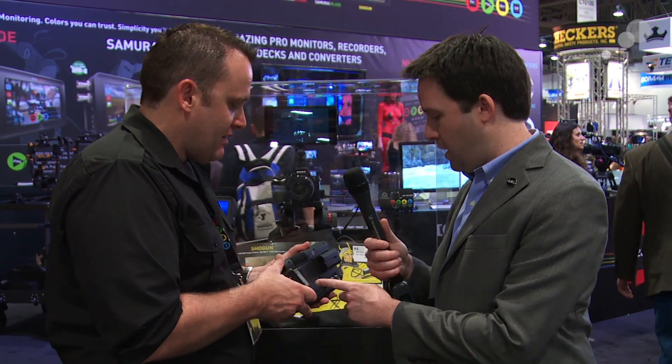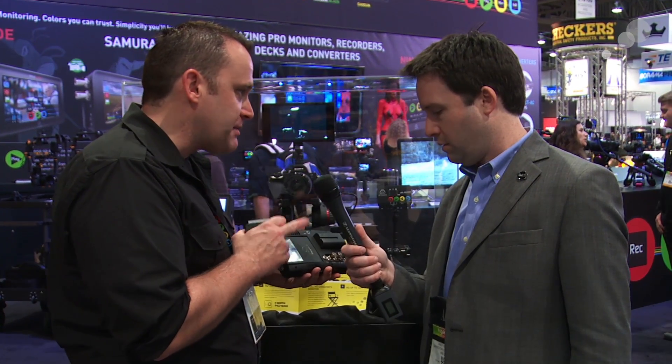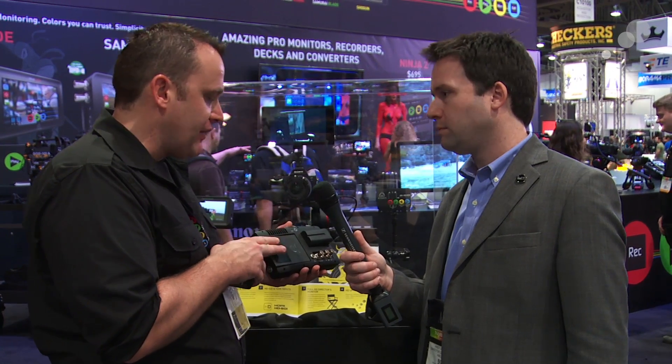So SSD, or spinning disk for HD. Plus we have a RAID module with two hard disks, because I didn't want to lose the low-cost recording selling point which our customers love. So you buy two 1TB spinning disks, put them in the RAID caddy which will come in the box, hit format on the unit, and away you go. You've got two and a half hours of ProRes 4K for about $100. Wow, very nice.